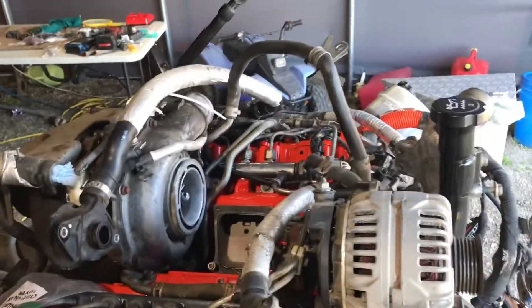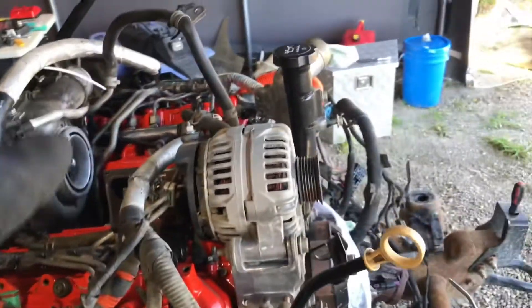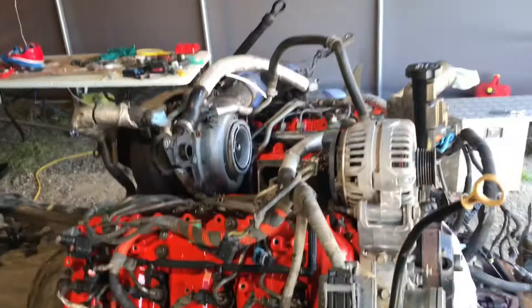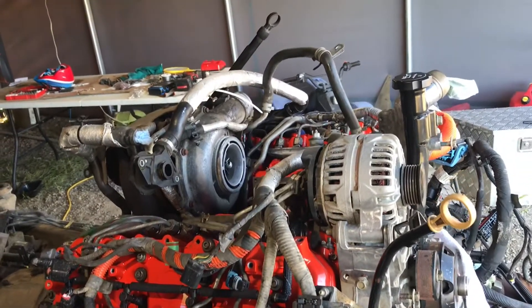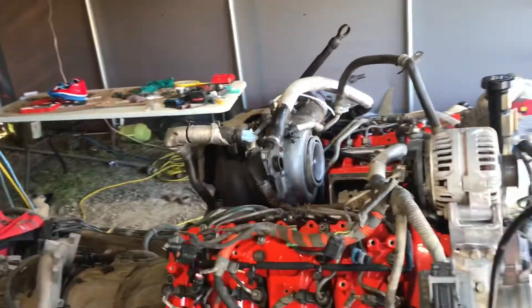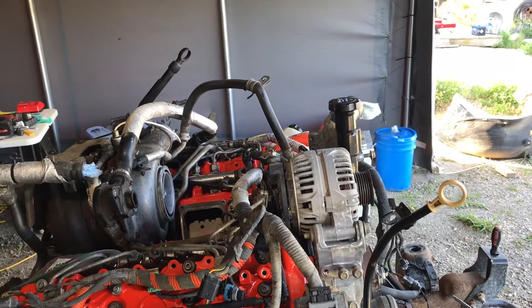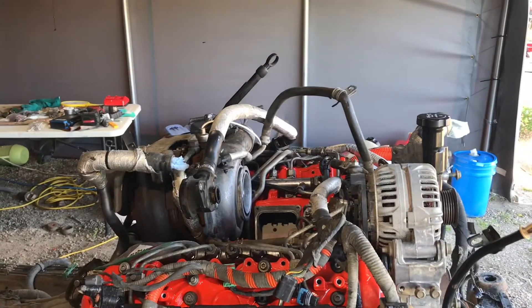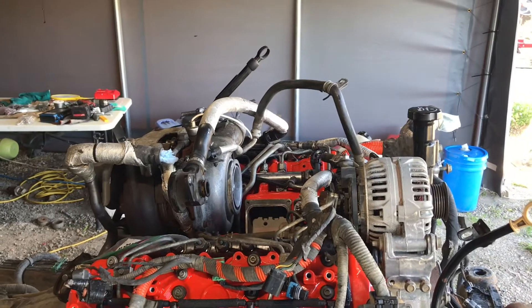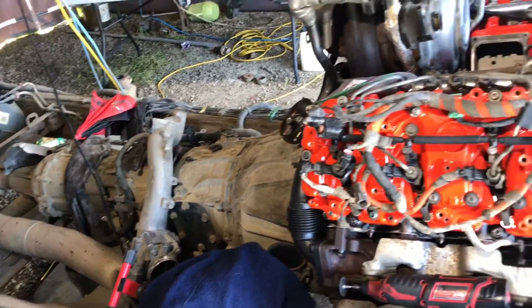So I figured I'd give myself a little bit of peace of mind to hopefully stop any potential problems. I'm ready now for the Y bridge. I'll put the Y bridge in, then the intake arm that comes over here with the grid heater and throttle plate on it. I'm going to put that back in and leave the throttle plate in there too. I believe I can buy an electronic unit to plug into my truck to control the throttle plate as an emergency shutdown system.